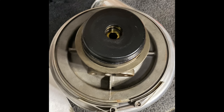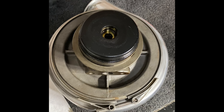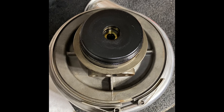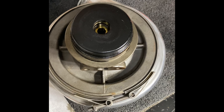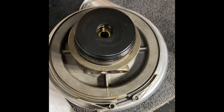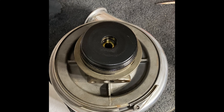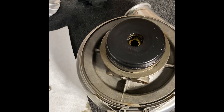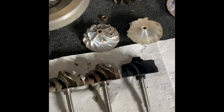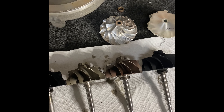Now, turbine sizes — there's a very wide array. Smallest I've seen is a 10cm. I owned one, sold it, didn't have any interest in it after blowing up multiple 11s. 11cm non-gated T4i and 11cm gated T4i both exist. 13cm gated and non-gated exist. 16cm gated and non-gated exist. 18, 19 — and the largest I've seen is the 24 Monarch flange, which would be on the ISX HX-55 version.